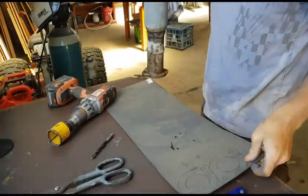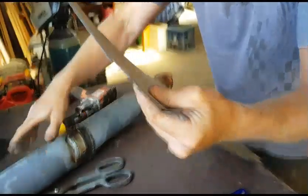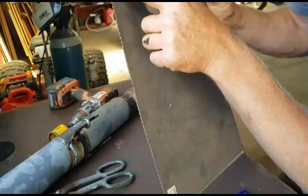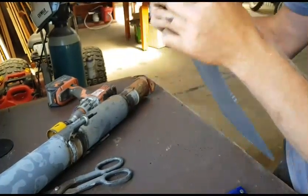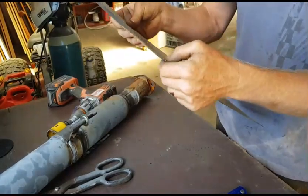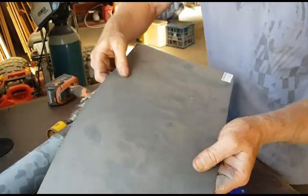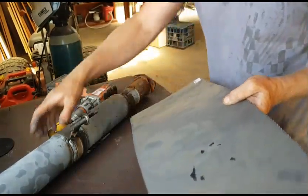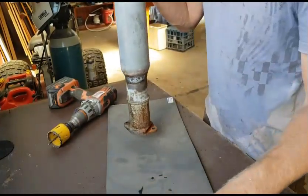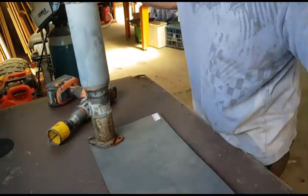This is the paper or gasket maker I was talking about. It's a fine piece of mesh sandwiched in between these two layers. And that one's for exhaust, anything hot. You could use it for water pumps and all of that, but there's no need, it's too thick. But for exhausts and manifold gaskets, it's great. So we'll just put this on here.